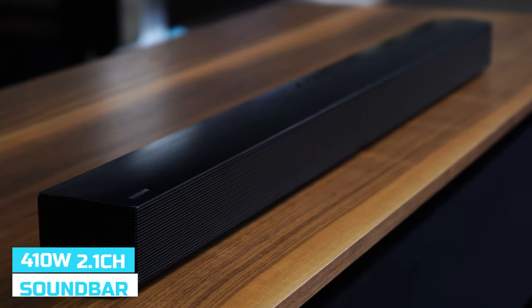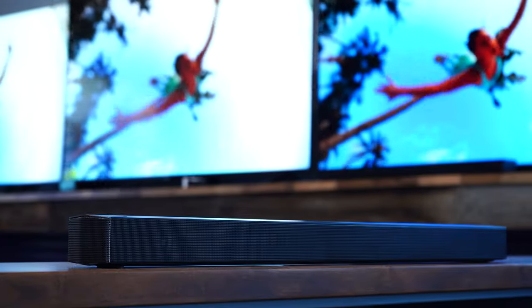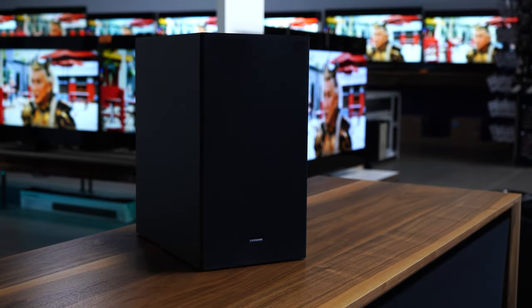Starting off, this is a 410-watt subwoofer soundbar combo. It's 2.1 channels, made up of five speakers — two rights, two lefts, and a subwoofer. Other soundbars have a center channel, like the 3.1.2 configuration in the 600 series, which can get complicated. So to clarify: yes, it's a two-channel soundbar with five speakers, but they're rights and lefts — not center speakers. The two drivers per side help mimic surround sound through certain surround modes, which is essentially artificial surround sound.